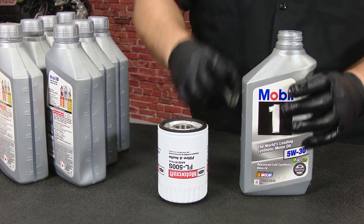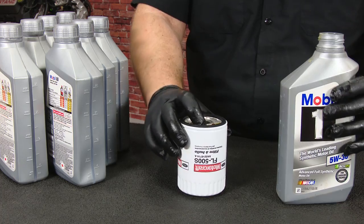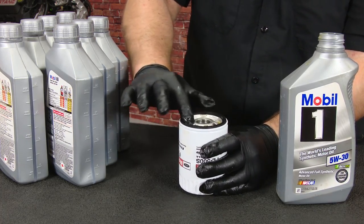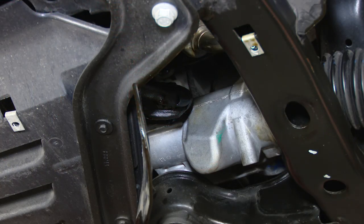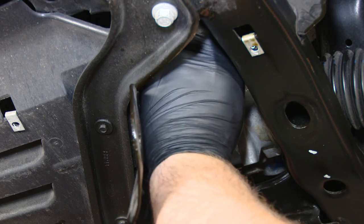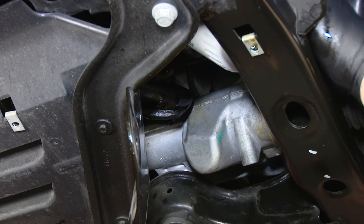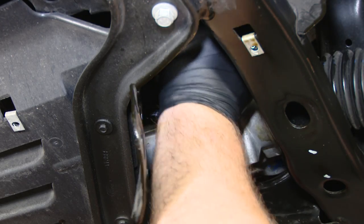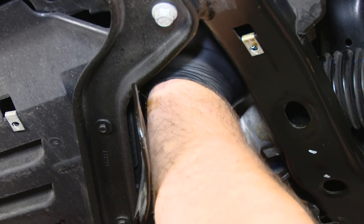Now if any oil dripped, you want to clean it up before installing the new oil filter. While there are arguments both ways, we like to put oil on our O-ring before installing the filter. Now we're going to install our new oil filter. Before you install it, you want to make sure there's no O-ring on the oil filter block — make sure the O-ring is still in the old filter. If you install this with an O-ring already on there, it will not seal properly. Tighten this by hand only; you do not need to tighten it with an oil filter wrench or you might not be able to get it off next time.